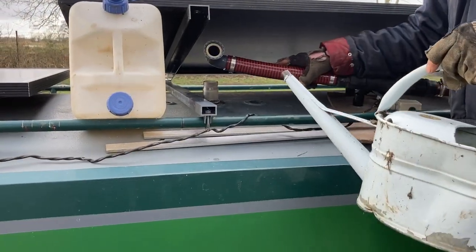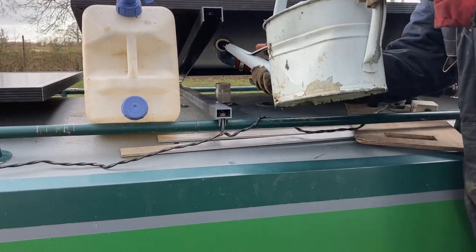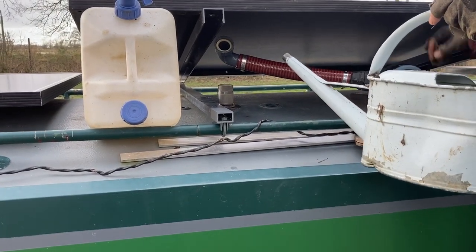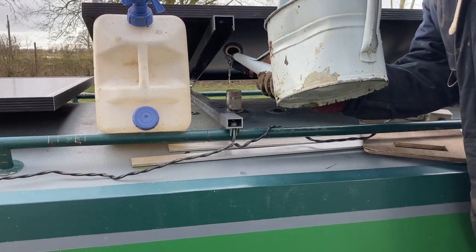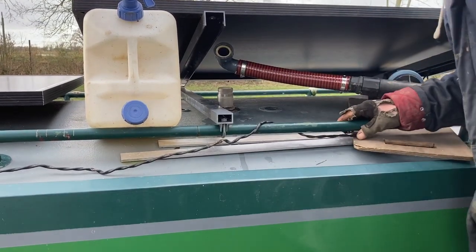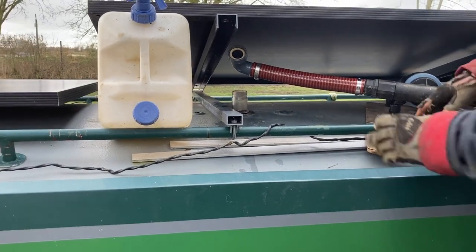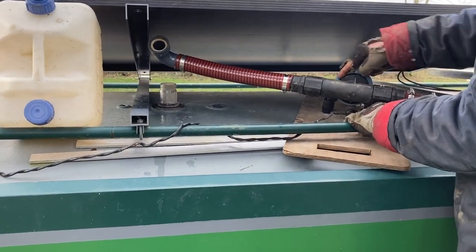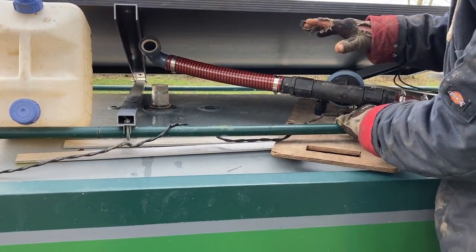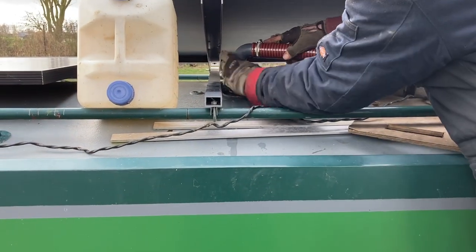I'm going to prime the pump up with a little drop of water, which just involves switching her on — just a little bit of water out of the tap. Pour a little drop more in there. They will go without priming, but it's just a little bit easier on your pump, a little mechanical mercy. It's just been sitting there a while, and obviously the diaphragm — the rubber diaphragm inside — and the little joker valves and stuff are all dry. So it just doesn't hurt to wet them up. It also gets better suction because of the seal inside.